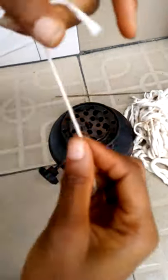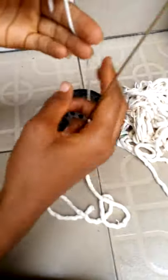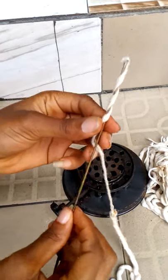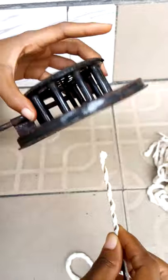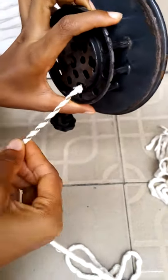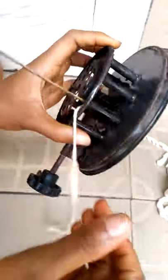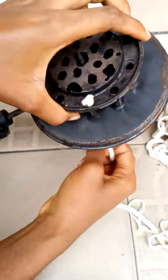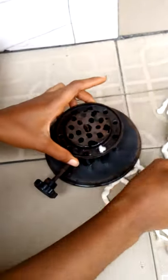Now you pick a wick — these long pads that are here. You take it and wind it inside your broom, try to round it on your broom like this, and then you put it through the holes in your stove burner. You pass it from the top, not from the bottom — passage from this side — and once you come out to the other side, you take the rope, remove your broom, and you pull it down.